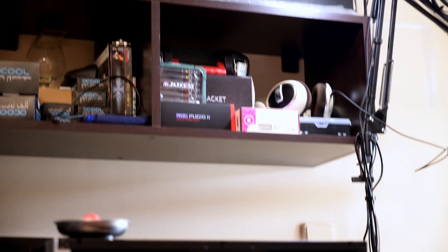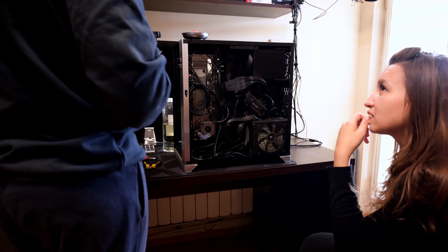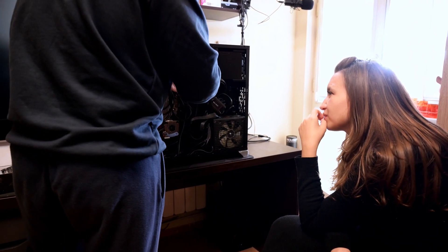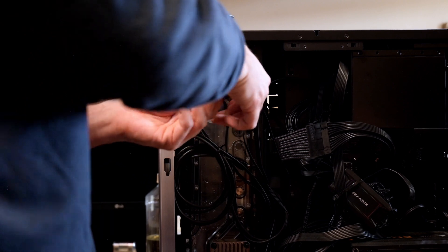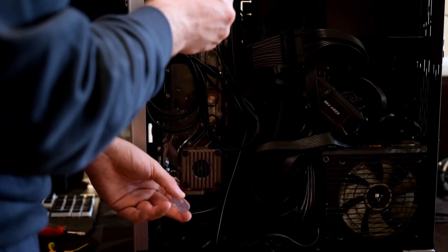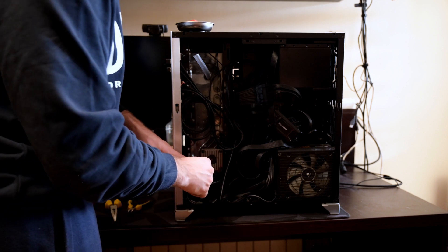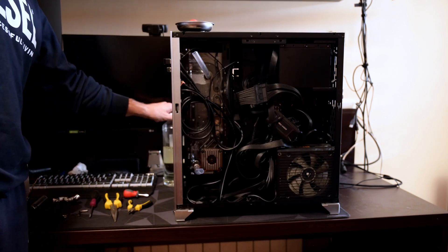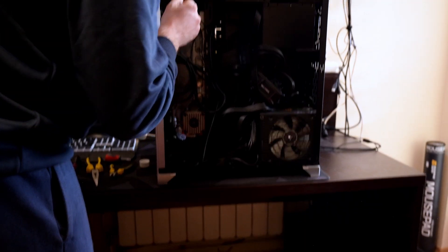I love your distro plate, it's so beautiful. I don't love it so much because it's very difficult to work with. But it does look more clean if you use a distro plate versus a reservoir. We'll now try to push some air into the system using a soft tube fitting. You need to make sure that the bleed valve is closed when you compress air, otherwise we can spray the camera. The liquid here is Aqua Computer — you need to use the most basic pre-mix.